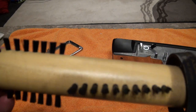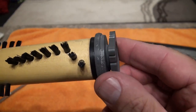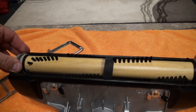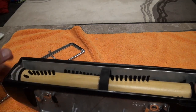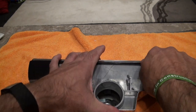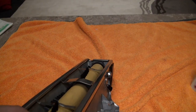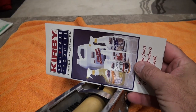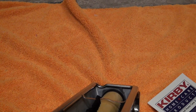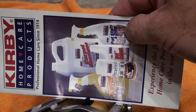So I'll demonstrate what happens. We'll put it back in on number one — number one on both sides — drop that back in, push it down, push your belt down, put this on here, and lock that off. Now what you do is get a ruler. I'll just use this Kirby card here. When you put that on, you can see it's set on number one, and zooming in, that is just up to the bristles — about two to two and a half millimetres.